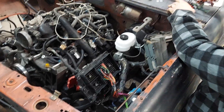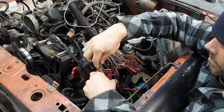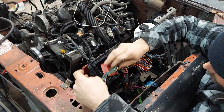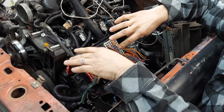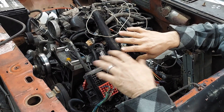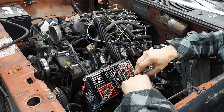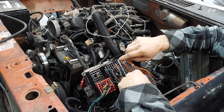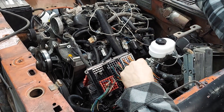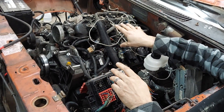When you got your donor, you want to cut your other connectors off because you're going to need that one and you're going to need that one — you're going to need these connectors. This one goes to the engine. On this connector, it's the A block, ninth pin — A9. This wire right here, you want a switched source from your truck to power this up. That'll get things alive and going on the engine.